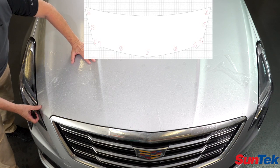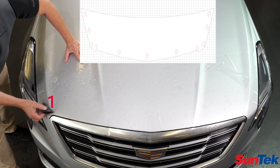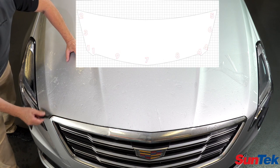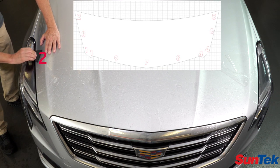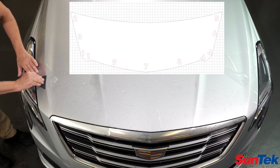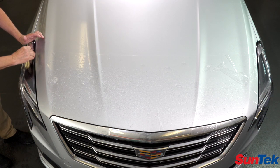This pattern is meant to be installed edge to edge, or as a lot of installers call it, coast to coast. So we're going to be on our passenger side with our lineup point right here. I have my solution mixed a little on the lean side so it sticks pretty fast. There's tack point number one. Back in the back I'm going to get over to my edge, give myself a little squeegee — that's tack point number two. And number three is just making sure we're good to the edge and finishing out this side, making sure it's aligned properly. As you can see when we do this the fingers come right out and everything lays nice and flat.